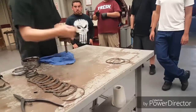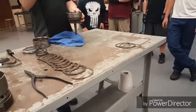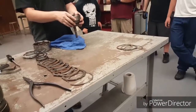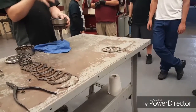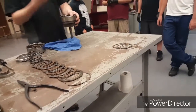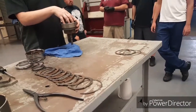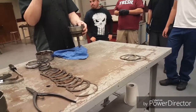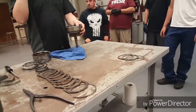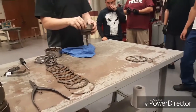So ATF acts like a lubricant? Well, these clutches are wet clutches — they should be 24/7 soaked in ATF. They're never meant to be dry. If I rebuild the transmission with dry clutches, it takes a while for fluid to get up here and splash on and soak them in. So that first five or six times I go to shift right after I rebuild it, I've got clutches with no lubricant, no friction modifier, no protection — and you're going to wear mileage off of them.